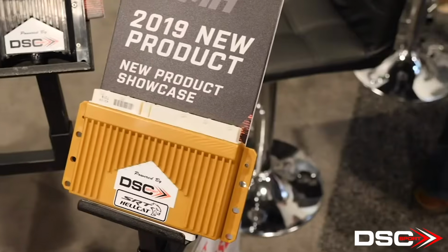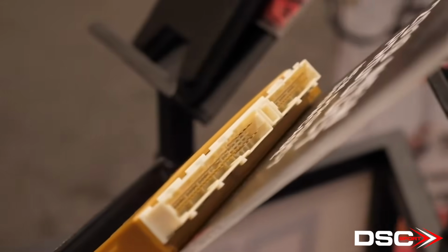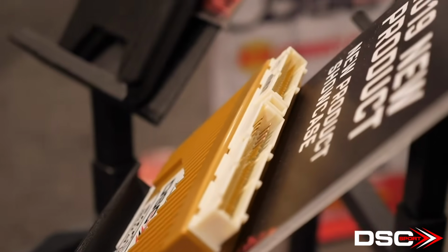What you just said is completely true. I've been doing this for 24 years, and you can definitely go down a wrong path in manual adjustment. So with the electronic, we mostly eliminated this possible error by providing a very good base map. Now, with our plug-and-play controller, instead of tuning for what you expect the peak load to be, we are tuning for the driver. So instead of tuning from the tire up, we're actually tuning from the steering wheel down. So it's using the driver's reaction, braking, steering, in order to trigger the next set of commands. In that way, it simplifies the tuning process because it's already pre-written in an algorithm. So essentially, you could put this in the car and expect a really good improvement over a passive system anyway.